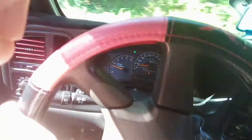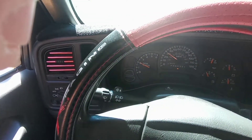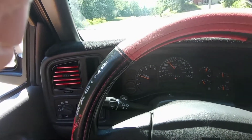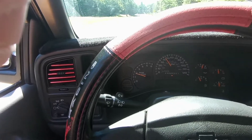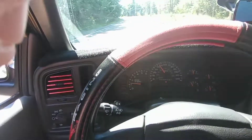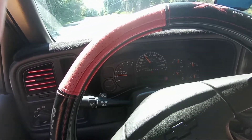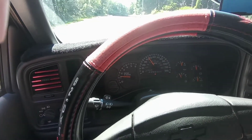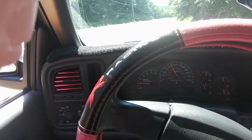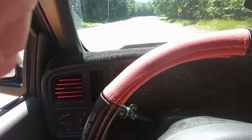Alright, so here we go — normal driving. I don't know if you can hear it, but it kind of hung up like it was staying in the same gear and then just randomly shifted. I was under the impression from what I've heard that whenever you disable torque management entirely your transmission is just going to go haywire — bucking, jerking, shifting weird — but so far it's not too bad. At the same time, there is zero difference on takeoff: you mash it to the floor and this thing takes off so slow, like a giant moving rock.